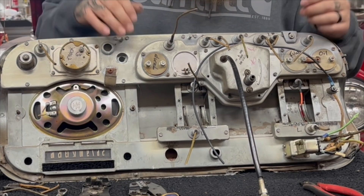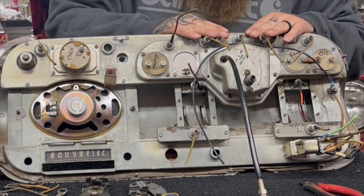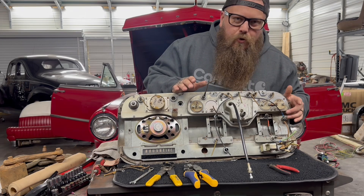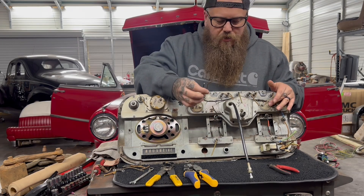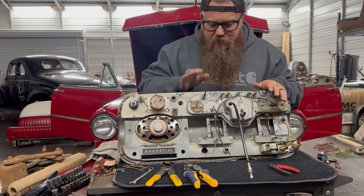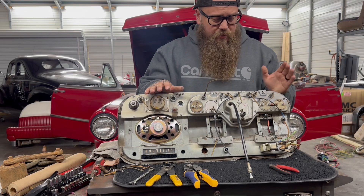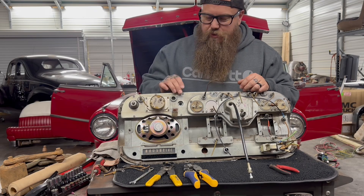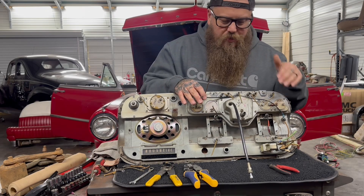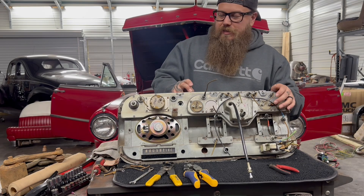This dash originally grounded through clamps — it wasn't even bolted to the steel, it just clamped on and the clamps pushed against the face and held it in. So really it's a clamped-on application, and we were hoping for a good ground connection for all these lights. Now I know we will have one. I like to do things where I have 100% control of every electrical circuit, and this is how I accomplish that — by putting grounds where there didn't used to be grounds. Simple stuff like this will make your wiring way more reliable. Clean all your grounds, clean all your connections — even for a light bulb — because you definitely don't want to take this whole dash apart just to reach a bulb. All fresh new bulbs, good grounds, good connections. Nice quick easy videos for you guys — see you next time!